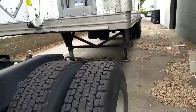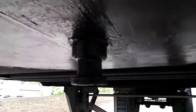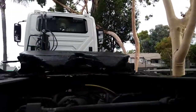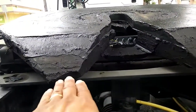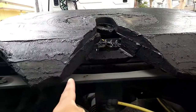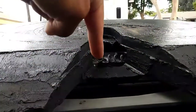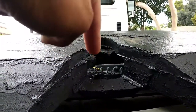Now, see the pin right here under the trailer — there's this middle pin right there. This metal pin is the thing that is going to connect to the fifth wheel. So you only have this space right there. This pin is going to come in and go all the way and latch and connect to the fifth wheel.